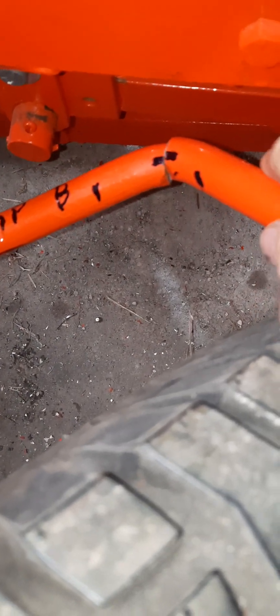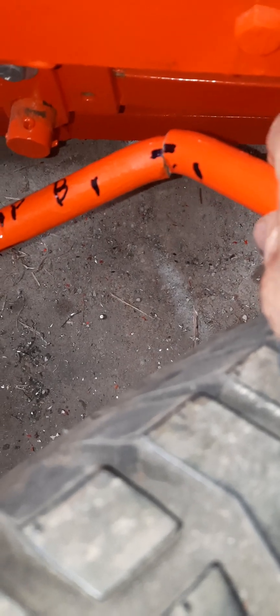So what you have to do is turn the steering all the way to one direction, turn the wheels to correspond to that direction all the way, get the drag link lined up to where it should be — and that's where it should be.